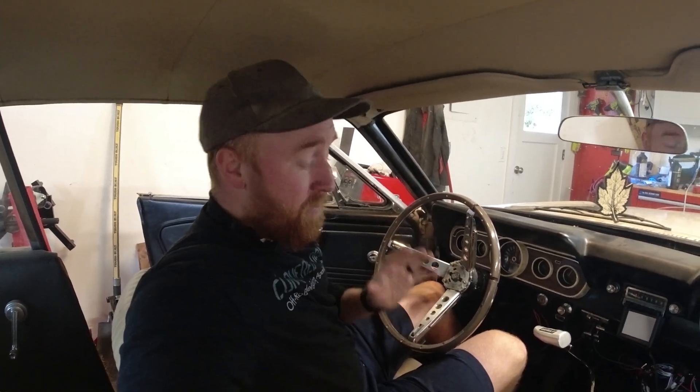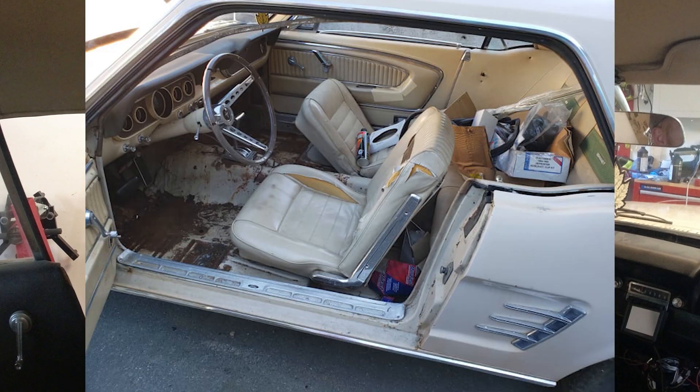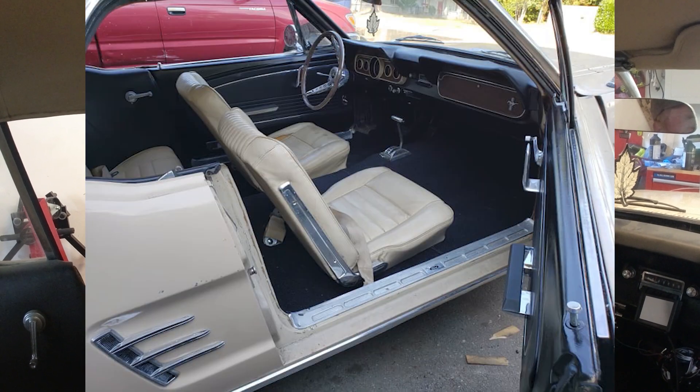The goal is to take this Mustang from the Ford Inline 6 and replace everything else while keeping it all looking very stock. The interior is going to stay stock looking. I'm redoing all the interior - taking it from when I bought it with rust all over the floorboards and torn seats, replacing it with all new panels, new carpeting. I cut out the floorboards, welded in new floorboards, put sound deadening material down. Along with the 4.6 liter swap, I've swapped in fuel tanks, done the transmission - a 5 speed swap with all new pedals since this was an automatic - all four corner disc brakes, Ford 8.8 rear end, all electronic fuel injection, custom cooling, a Holley Terminator X wiring standalone harness, and pretty much everything else you could think of.